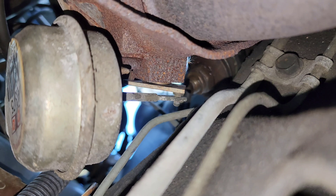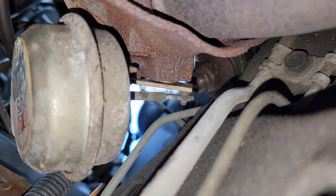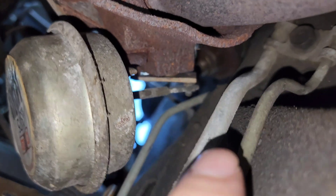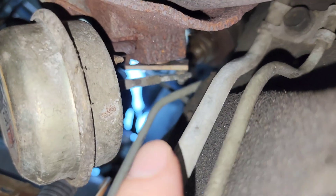Here's a view of the backside of the valve. You can see the rod that sticks out and is attached to a mechanism which controls the actual butterfly valve inside the manifold. When the engine is cold and started, that rod coming out of the valve will retract, closing it.